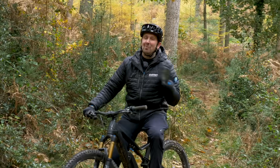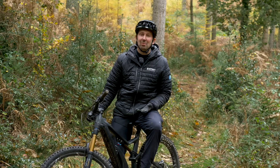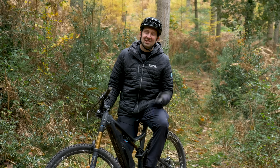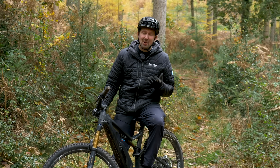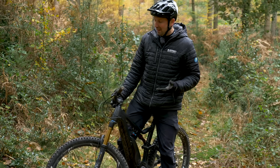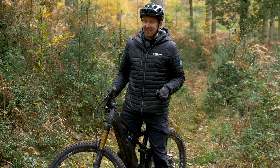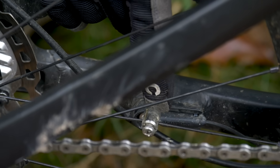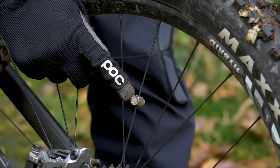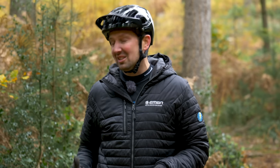How fast does an e-bike go? Most e-bikes are restricted to 25 kilometers per hour in most of Europe, or 32 kilometers per hour in the States or Canada. It doesn't mean you can't go faster than those speeds — it's just the speed at which the motor will assist. If you go over that limit, it's up to you and how hard you're pedaling, and your elevation can help too. The bike knows its speed via a speed sensor, usually on the swing arm or back of the bike, with a magnet that counts wheel revolutions — combined with the heads-up display, it knows when to assist and when to cut assistance.